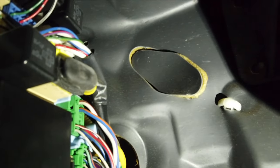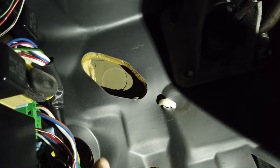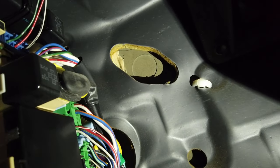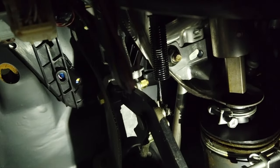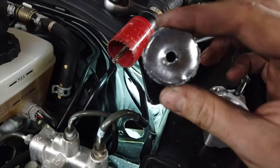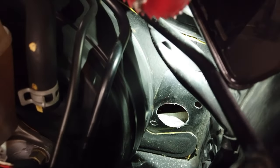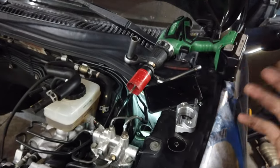Back inside the car, you want to check the pedals. All the way down there is a little opening where the clutch master cylinder should sit — it's already pre-cut. You can see where you need to drill: two holes on the side for the bolts and the big one in the middle for the push rod. Under here we can also access the brake attachment points — the pivot up there and the push rod. I'm going to get the brake out first to make more room to drill the clutch master cylinder holes. I just got the big hole done — that's how much material I took out — and we've got a nice clean hole. I'm going to clean it up a bit more and protect it against rust, then we should be good to bolt everything on.